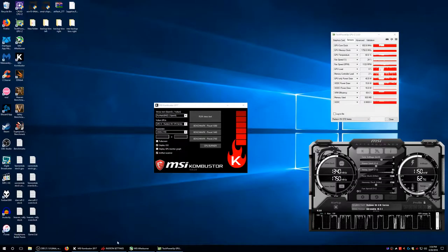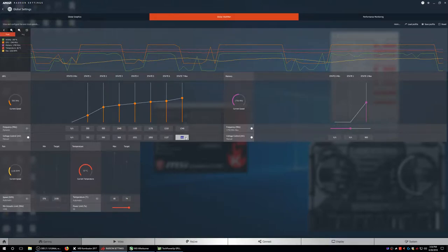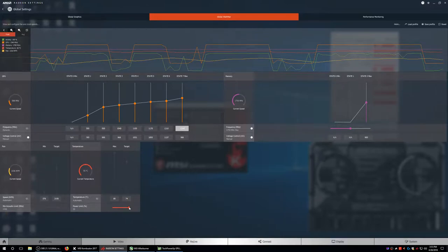That's about the lowest I can go. Later today I'll run that for about an hour and see if we can keep 980 mV. If not, then I'll run another hour at 1000 mV. So let's go ahead and underclock this back to 1244 MHz, which is what it's supposed to be at when it's not GPU boosting to 1340. Let's see if we can still get back down to 900 mV, starting at 980 mV.